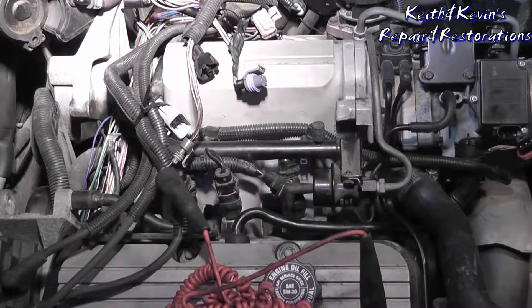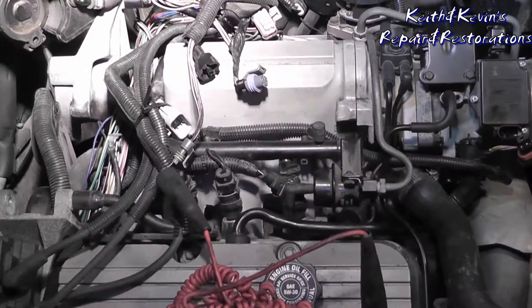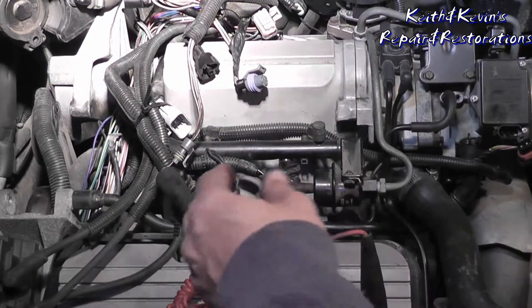This diagnosis has been a bit interesting but I did figure it out. I do have one wire that's burnt. I thought I was dealing with some uni wire. What I elected to do was figure out which wire is actually cutting my ignition circuit off, and I did figure it out. Let me show you how I figured this one out.